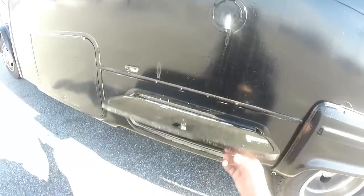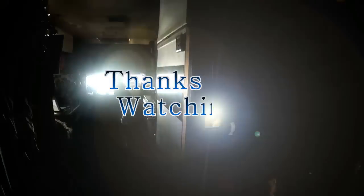That's my heating source. I found that if you use the internal furnace it sucks down the gas. This is the furnace here, which I do not use currently, but I'm actually going to replace it with a more updated digital one because this old one is so inefficient. That way I can use the Mr. Buddy when I'm awake and the furnace when I'm sleeping, since the furnace shuts on and off automatically. I can set it to a temperature along with my electric blanket. But before I start using it I want to put a digital thermostat in, and I'll show you all when I install it.